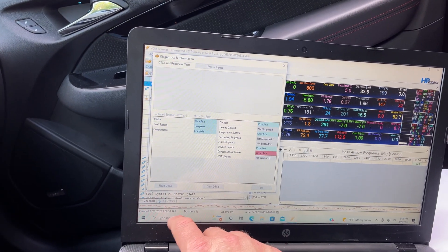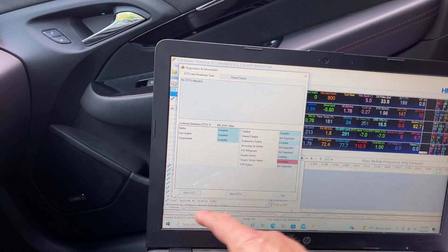I just hit read again — it's still incomplete. My guess is it's going to stay incomplete until tomorrow because there's no reason for the heater to go on since the car is warm right now. We'll see tomorrow morning. As long as I don't hit clear DTCs again, I should be back in business. If your tune is right, the rest of the stuff should be right.